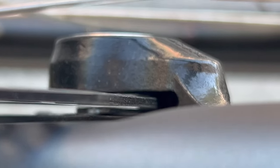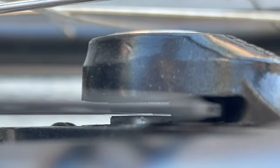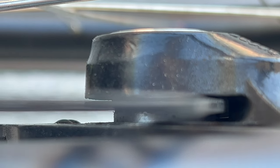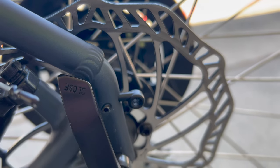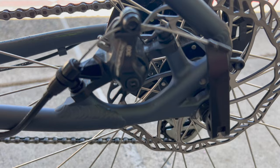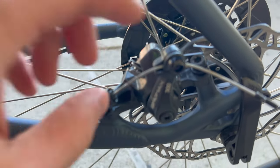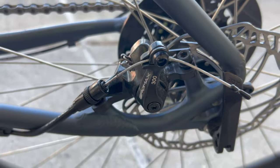There's the front brake caliper. Zooming in, you can see that if I articulate the brake, it actually squeezes the rotor. See the gap? Not touching the rotor. Give it a squeeze — it squeezes. By squeezing, it creates friction, and that friction is what slows the front tire down. That's controlled by the left lever on the handlebars. These disc brakes are common on motorcycles and scooters, but bicycles didn't get them until later. Original V-brakes would squeeze the rim with brake pads. This is more like a motorcycle setup — it's mechanical, not hydraulic, so it requires more hand strength to articulate.